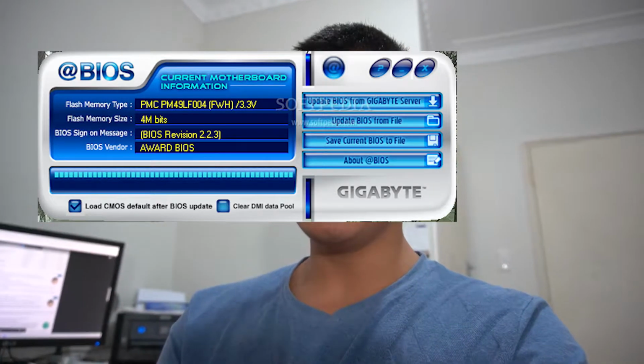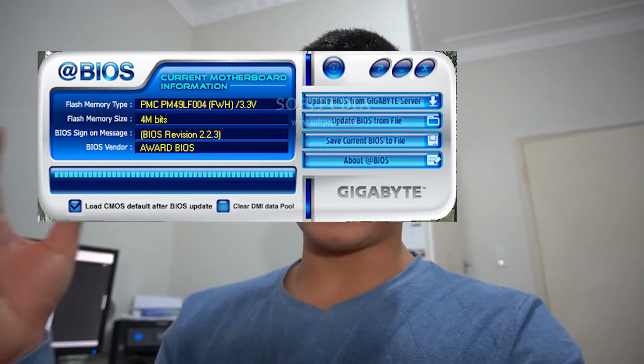There's ones that work inside the system, like an installing app you can do, and also you can use on Gigabyte motherboards something called QFlash, where I believe you put the BIOS file on a USB stick, and then you can flash it in the BIOS to the motherboard. And you can't do this with the GPU installed, as it's frozen, as you saw before. But hopefully it works.